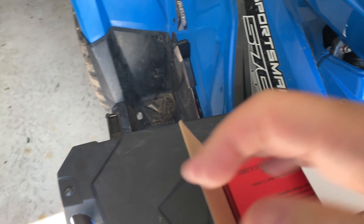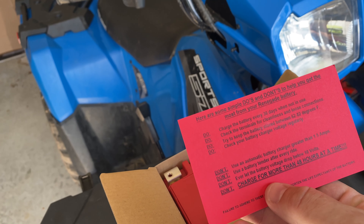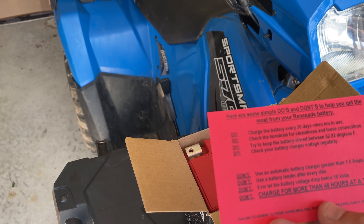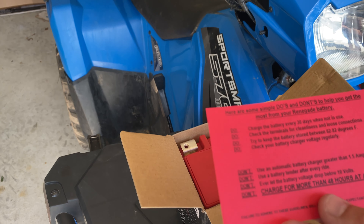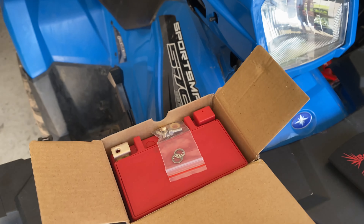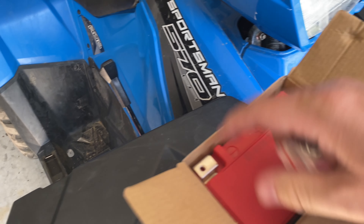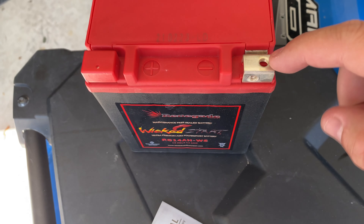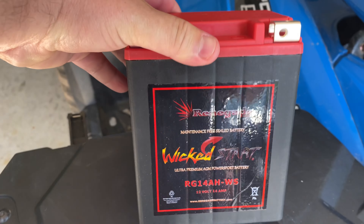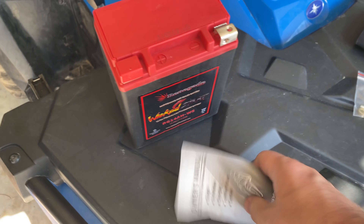On top we have some simple do's and don'ts. This battery should be charged every 30 days, but they say don't leave it on the tender all the time — that's actually bad for it. Just top it off every 30 days, store at a specific temperature, keep it clean. They say don't leave it on the tender for more than 48 hours. It's a less hassle battery since it's AGM. They give you the screw terminals that can go on the top or on the side — here's the negative, here's the positive. It's sealed so you don't have the caps on top to add water.